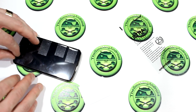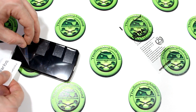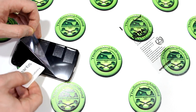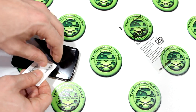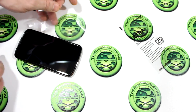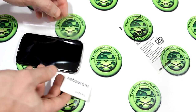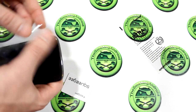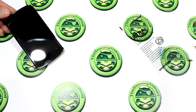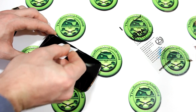While we've still got the front protector layer on it, we're going to work out whatever little bubbles are left — like that little one there, getting the edges, little ones over here, and so on. Now we're going to go ahead and peel this off. Some screen protectors, as you're peeling the top piece off, might start trying to raise the screen protector itself, so you're going to want to use your squeegee to keep that down. So we go along like that. And then we go ahead and finish up by squeegeeing out the rest of the small bubbles.